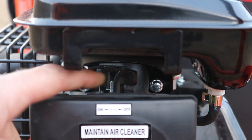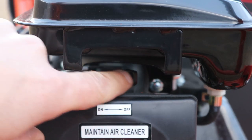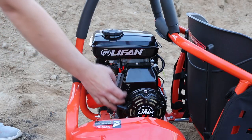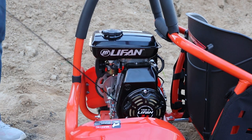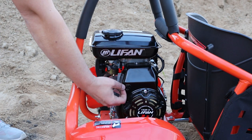Next, here at the back of the engine we have the choke. This plastic here is the choke, so you have to pull that choke to the left — this is on now. Next, pull the pull-start gently a few times. First, do it slowly, till the engine starts.